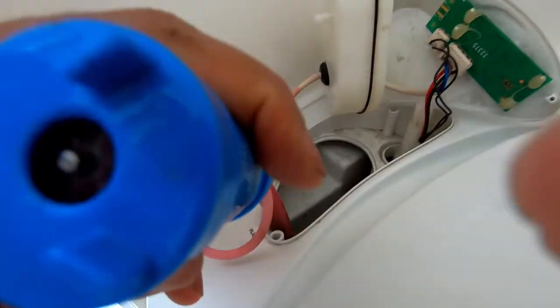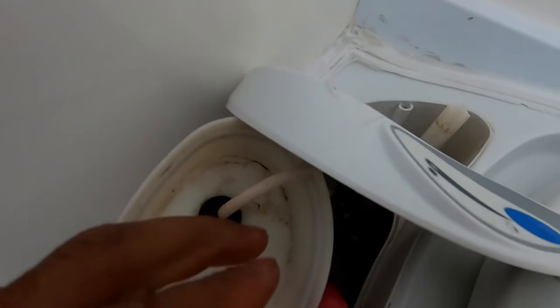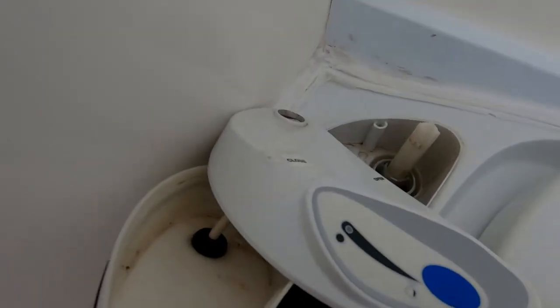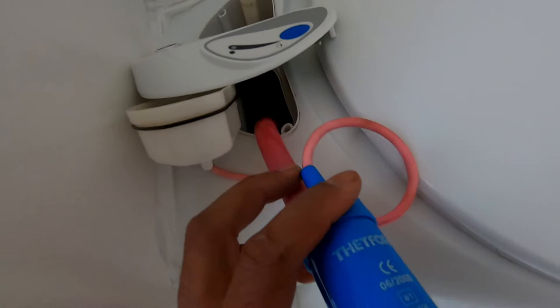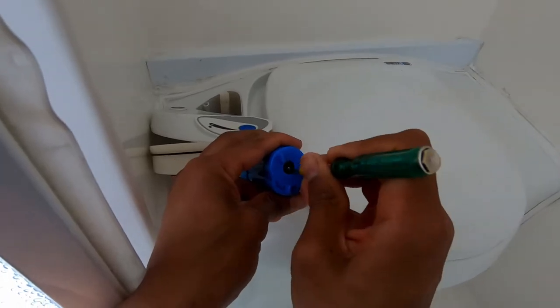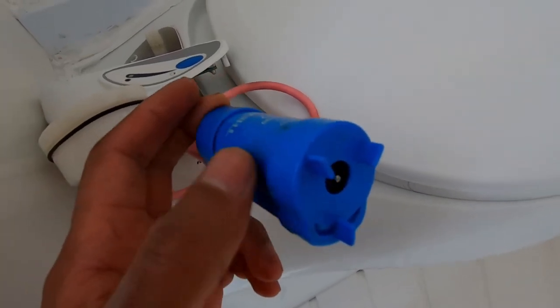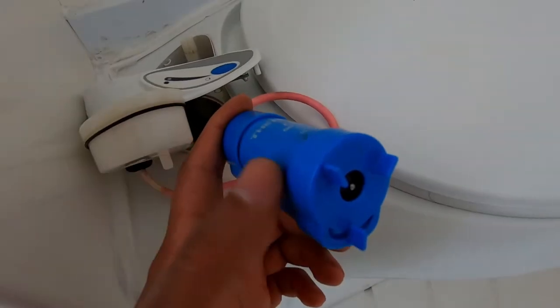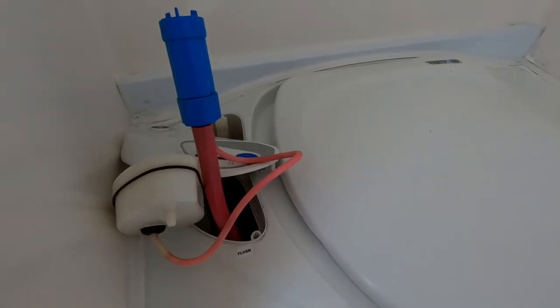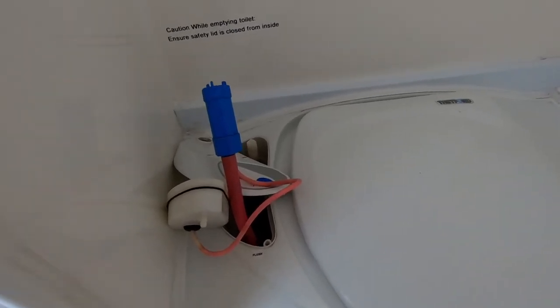And there's the pump. When it comes time to replacing the pump, all you have to do is cut the wire here. The replacement pump normally comes with a set of crimp terminals and you just crimp on the new pump. As you saw, I tried moving the impeller with a screwdriver but it's completely seized — that's the common problem with these pumps, they seize up fully. So we'll go ahead and replace this. You can get a genuine replacement pump or an aftermarket one — I'll leave some links in the description and you can make up your mind on which route you want to take.